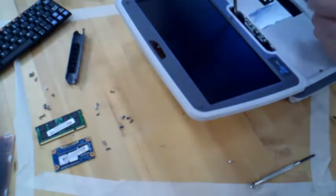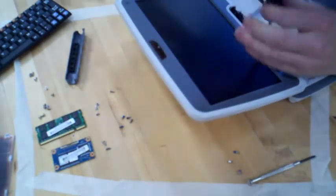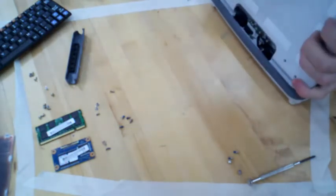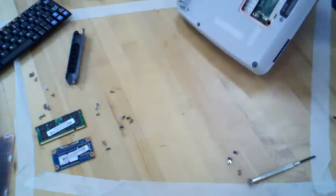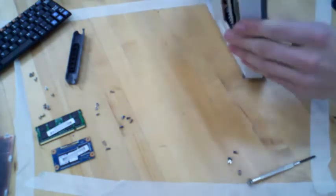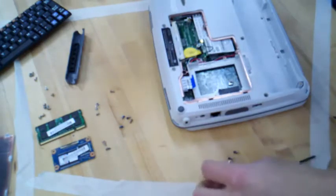You're going to have to take those out too. At this point I forgot there's one more on either side, on the underside — so you've just got to flip that over. They're right next to the black label indicating the battery information, input voltage and amperage. It's right next to that sticker on the underside, or on either side of it. Once you get those two out, you can pull off the lid.